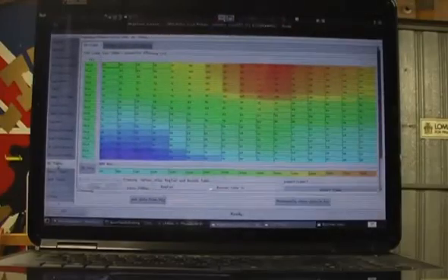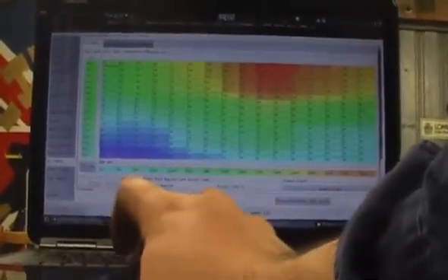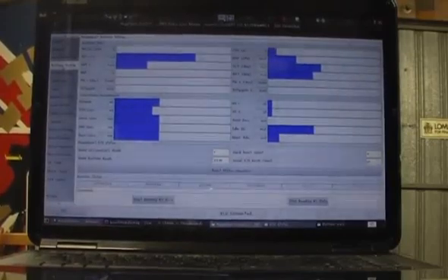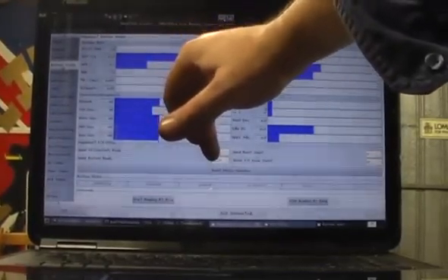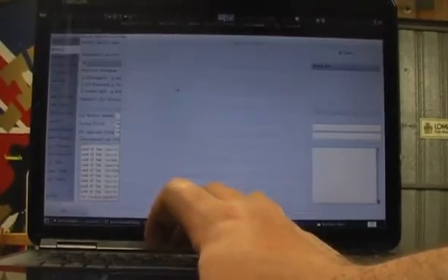You can hear the fuel pump going on — I'll just disable that. We'll go to offline mode. This is the runtime display — well, this is the basics of it. There's a whole bunch of digital gauges we can get as well. You can see if I turn the throttle, TPS goes up — throttle position sensor. A whole bunch of other cool things: manifold air pressure, coolant, air fuel ratio, revs, pulse width for your injectors. We can even choose dashboards as well and load something fancy up. When the bike's started you'll basically see all these bounce around.